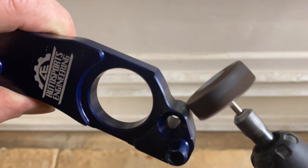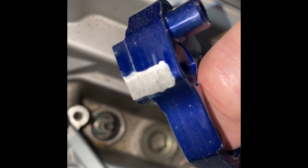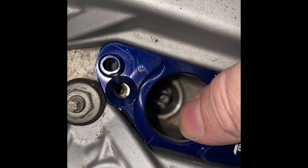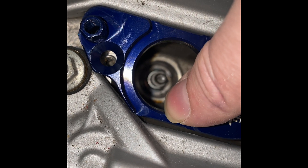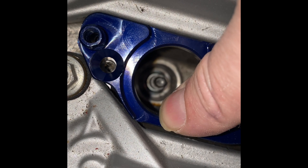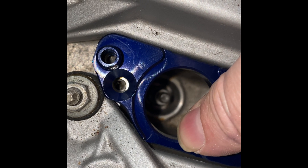So that I didn't remove too much material all at once, I just took a little bit of material off this front right-hand side, as you can see here, and I kept removing more and more of that material. I found that there were a few other points that also interfered with the valve cover. You just have to cautiously move this bracket front and back, left to right, and just keep removing material until you get an adequate fit. I'll show you in the next clip more of what was removed overall.